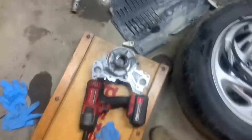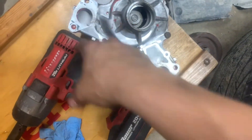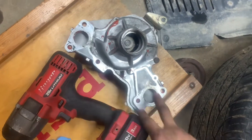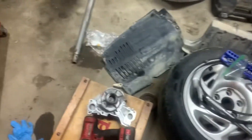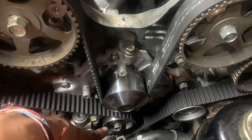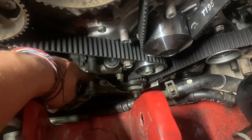After the last clip, here's what happened: take your water pump off and split it in half — after you take all the bolts out. Get your new gasket in between the two halves — it's a round one — put it together and bolt everything together. Then put the gasket on this side using some RTV, sit it against there, and torque everything up to spec. Then do the timing idler and tensioner — tensioner right there, idler right there, pre-bolted on. These are 46 foot-pounds of torque spec; I also put blue thread lock on the new tensioner bolts.